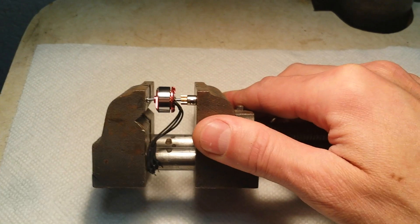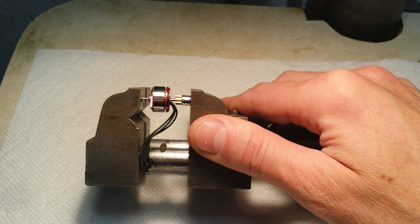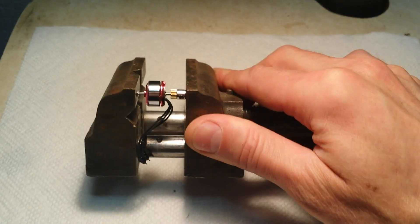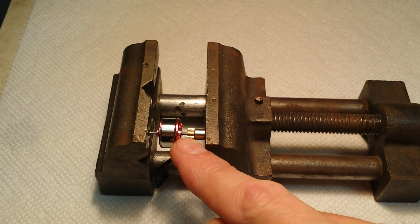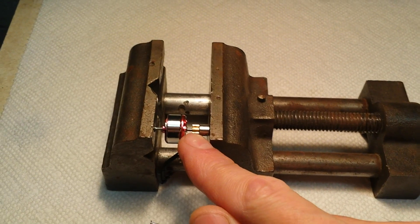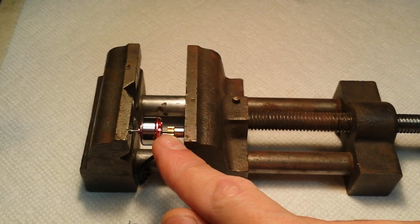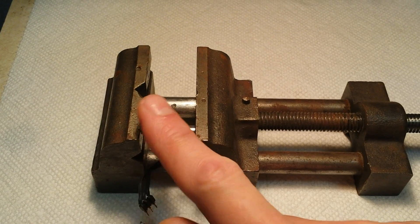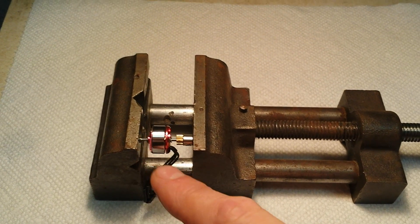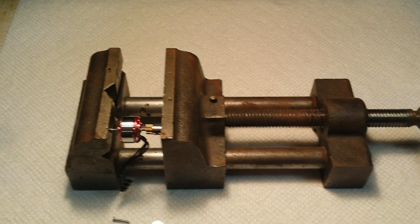It's really your choice, but I personally find the vise easier. After you press the motor pinion on, wait at least an hour for the thread lock to fully cure before you fly, or try it under a load — whatever you're using this in, like a car.